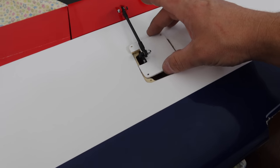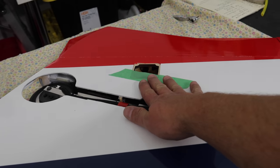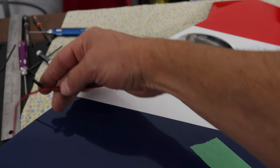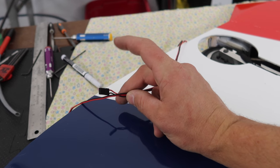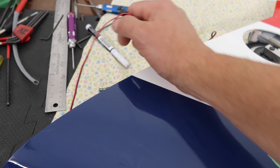With the brake line, leave the snakeskin too long intentionally. You want it long so it stays down in this area when the gear is up. If it's cut too short it'll create a catching point and bunch up as the gear extends. You want it to flow nicely in behind the gear — that's the whole point of using snakeskin, plus protecting the wire. The right wing is now complete with the gear install. We'll leave the covers off until we get the light back.